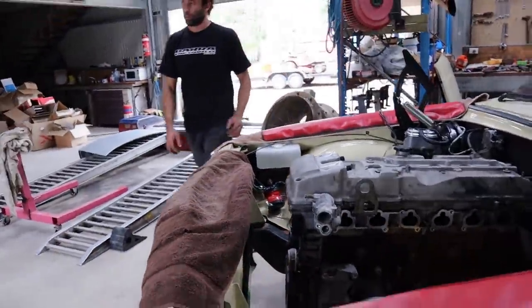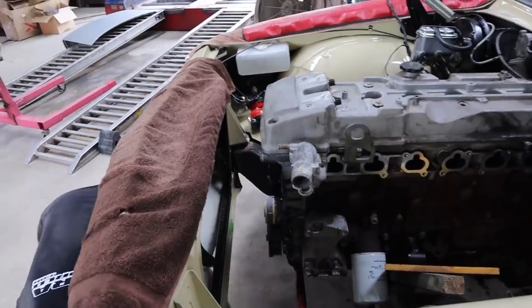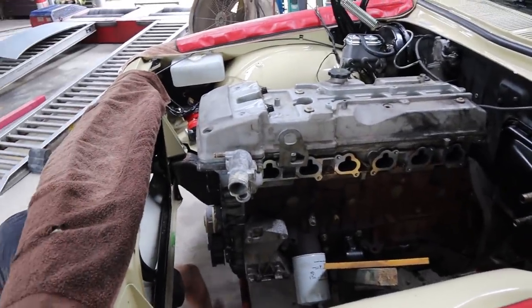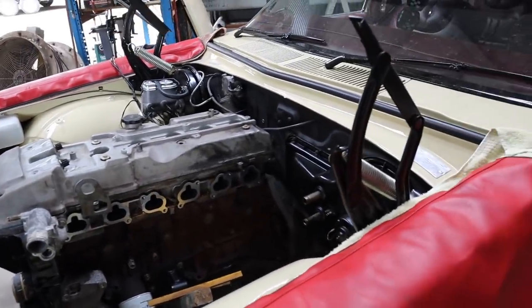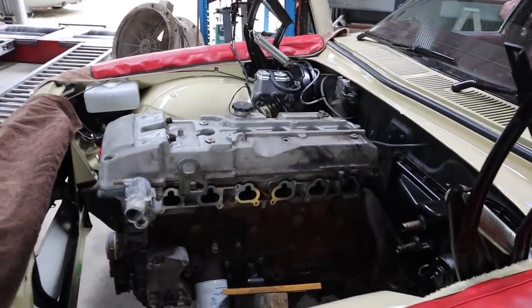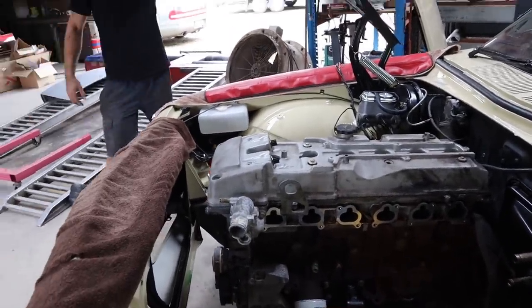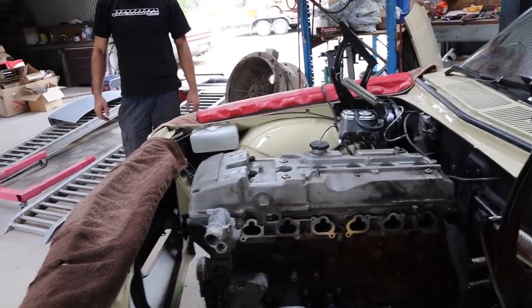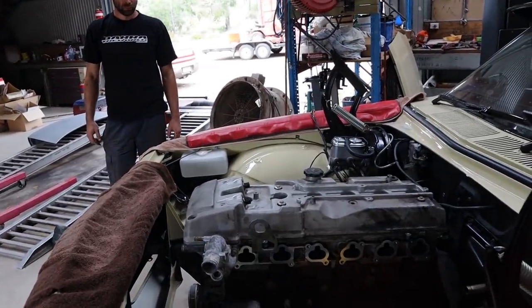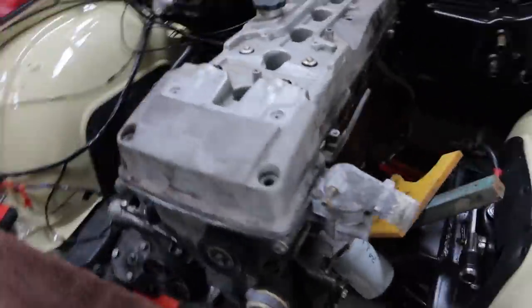In fact, I'm pretty sure it's still going to have to come up a little bit because the sump is still very close to that drag link — pretty much on the drag link still. It's as far back as we can go for a few reasons, and it's as far up as the gearbox can be as well. That's pretty much where it's going to have to work. So at this point we're just going to try some bonnet clearancing and see how it looks with the bonnet on.